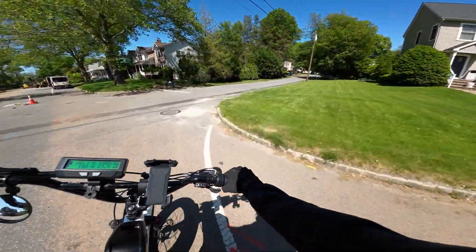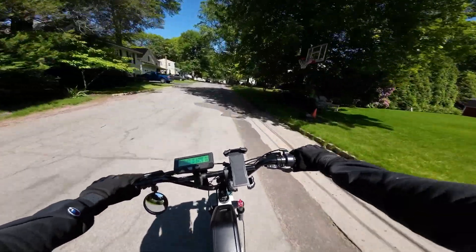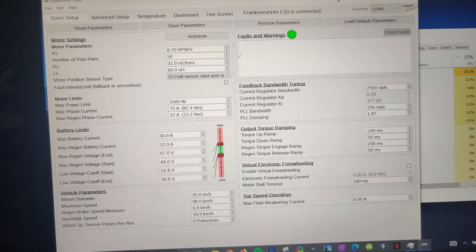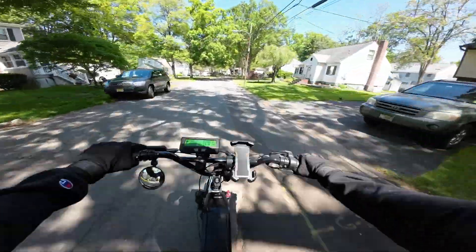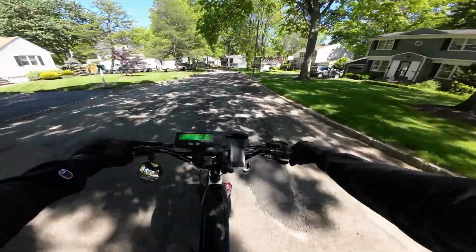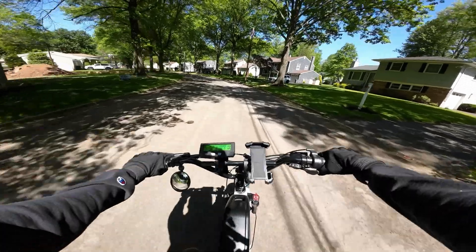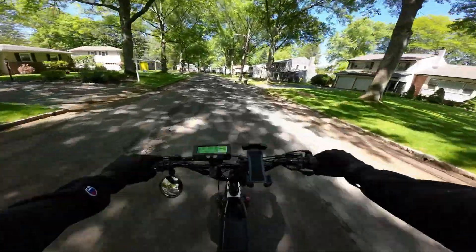The last thing to do is put the new display on the handlebars. I have BMX bars on the bike — I'm a huge fan, bought them on Amazon for about $30, link below. Once everything is connected, there's the Phase Runner app you can use to set the parameters. This controller is fully customizable — you can run it at any wattage you want, up to a 72V battery. This build runs at 60V with the wattage set to 1,500W.